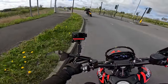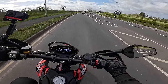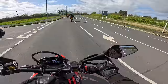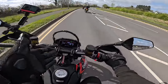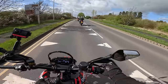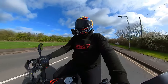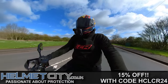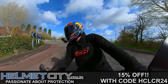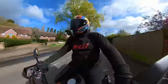You've got to give it a little bit of revs pulling away. I actually stalled it when I came out initially because it's so lean at the bottom end due to Euro 5. I'm not just picking on this bike — this is like a lot of bikes. But a big single is even more difficult to get through Euro emissions, and that's why you don't see many of them. They've got to make them lean, so you've got to give it some revs as you pull away.